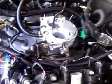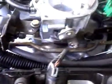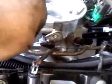And here's my throttle body. Also, my transmission kick-down cable — I took it out of a TPI setup and it actually fit perfectly. I just got to adjust the cable; I got to cut it maybe up to here, but I'm probably going to give it a little more slack so I have some adjustment.